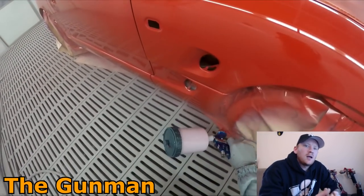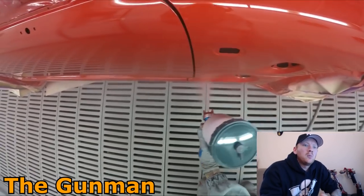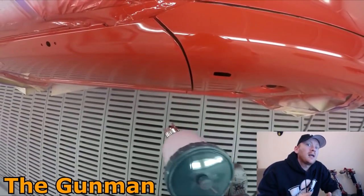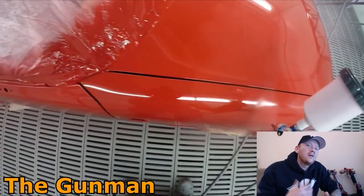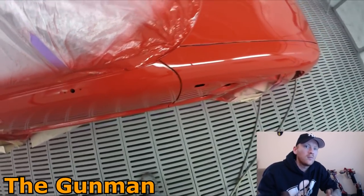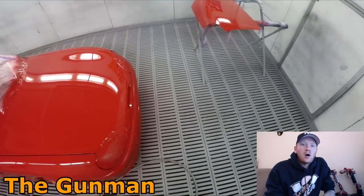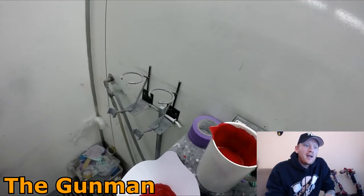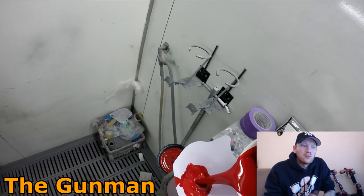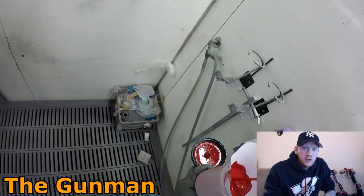Like a larger car, maybe just go a little bit more. If you're inexperienced, maybe just go a little bit more. If it's a coarse metallic, go a little bit more. If it's a red, or if it's a yellow, or even some greens — especially in the solvent range — maybe just go a little bit more. And as for clear, usually I will just order in a 7.5 litre kit for a respray. Again, you'll probably be left with a litre or two, but it's usually something that will always be handy to have around.